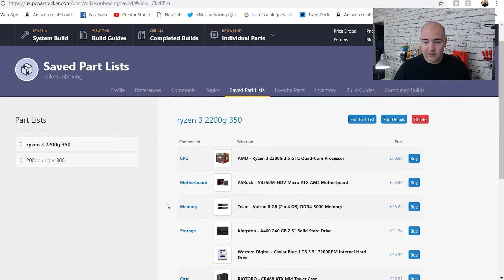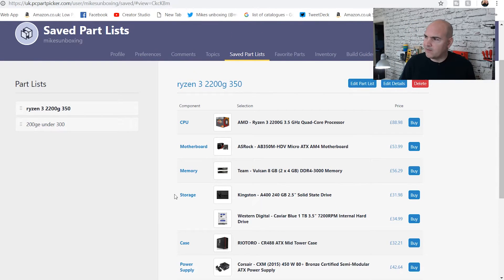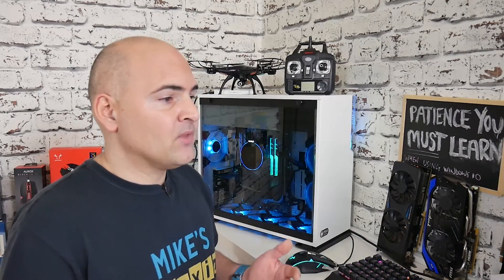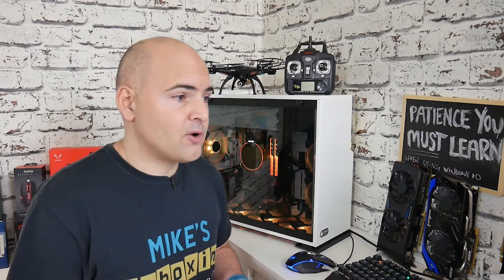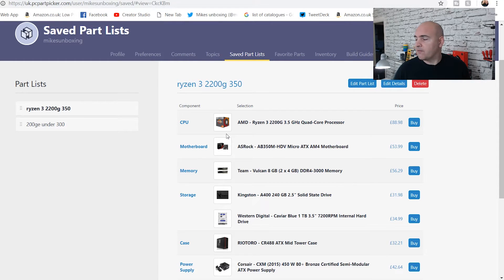If you want to spend a little bit more money, moving up to the Ryzen 3 2200G — this entire system comes to £341, just under £350. So you're spending about an extra £50, but getting more for your money. The Ryzen 3 2200G is 300 MHz per core faster than the Athlon, with optimizations in Ryzen making it snappier, and it has four dedicated cores. You also get the Vega 8 graphics over the Vega 3, so the extra cores, extra frequency, and extra execution units are much better for gaming. The Ryzen 3 is also overclockable — with a little tweaking you should be able to get it up to 3.8 GHz or slightly higher.